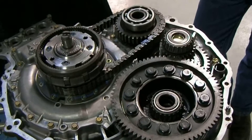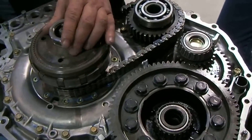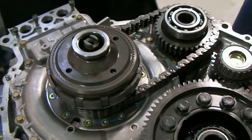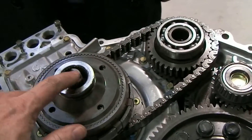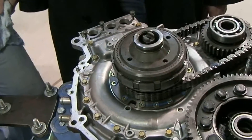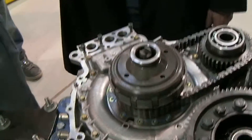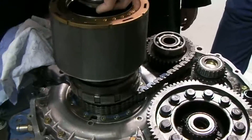Would you agree that this is the most complicated part of this Prius transaxle? Yes. This last piece here that we just put on — what goes on that? This notch right here is for the little oil pump drive. Grab that rotor and stick it in there so we can see how that looks.